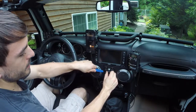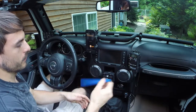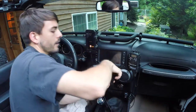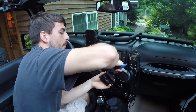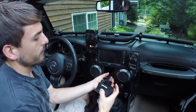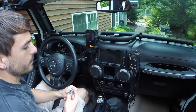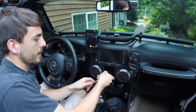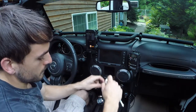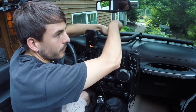We'll start by popping the window control free. Come in from the side while pulling outwards and just slide that in there and pop it free. Then you've got a little red clip you have to pull up on to unlock the plug, and once you do that it will come free. That exposes our first seven millimeter screw — go ahead and get that going. Make sure you don't drop it back into the dash; I'm setting mine in the cup tray to keep it safe.